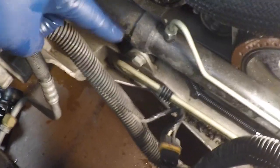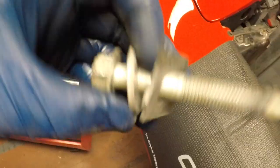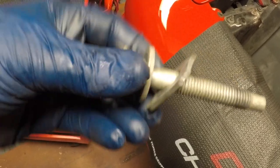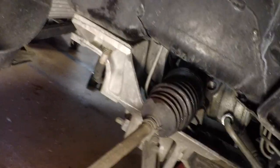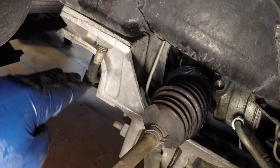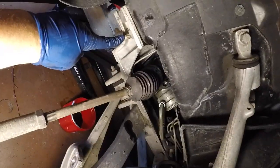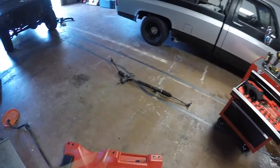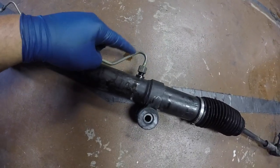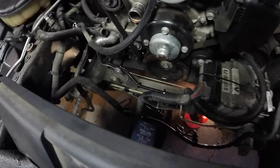After the power steering lines, we have the two mounting bolts for the steering rack. I'm not sure what's going on here — I either broke something or this is rigged up. Now the steering rack is all but ready to come out. The last thing to do is on each side there's a subframe bolt we need to back down a couple threads, pretty much till it's at its last thread, just to lower the subframe. I relocated the jack stands and now have my floor jack supporting the cross members. After wrestling with it for about 20 minutes I got the steering rack out — once I took the extra piece off it was a breeze.